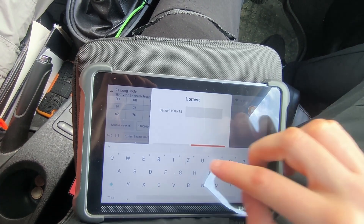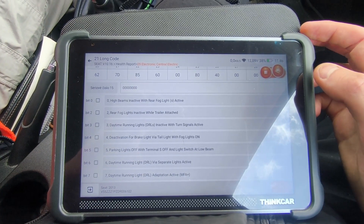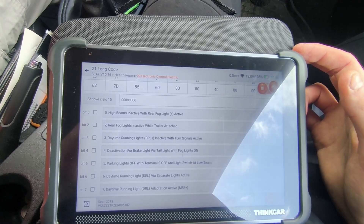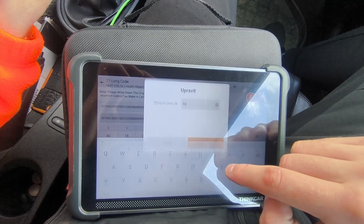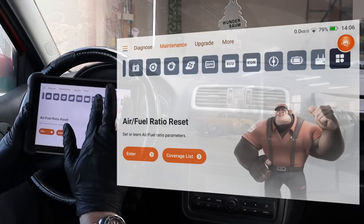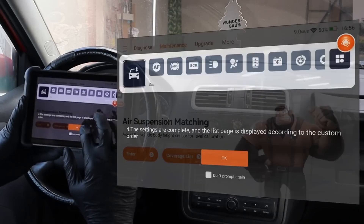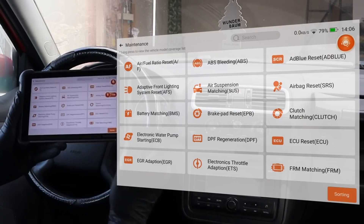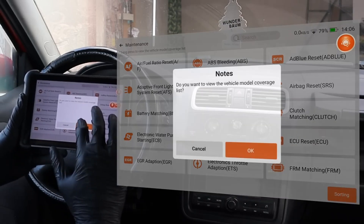It has very complex ECU coding. For example, VAG cars have a specific OBD2 system, and if you want to unlock hidden features in a VAG car you have to do it through long coding and adaptation — specific functions to VAG cars. The ThinkScan is still able to use this long coding, and you even get a nice long coding helper that tells you what each change will do, making ECU coding very easy to use. This was actually the first scan tool that came with free lifetime updates in a tablet scan tool format.